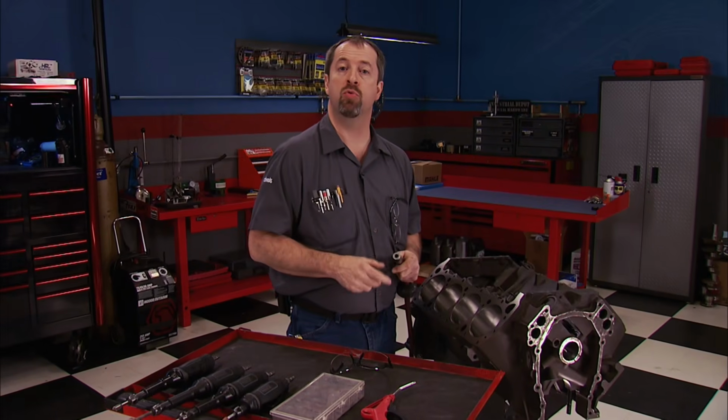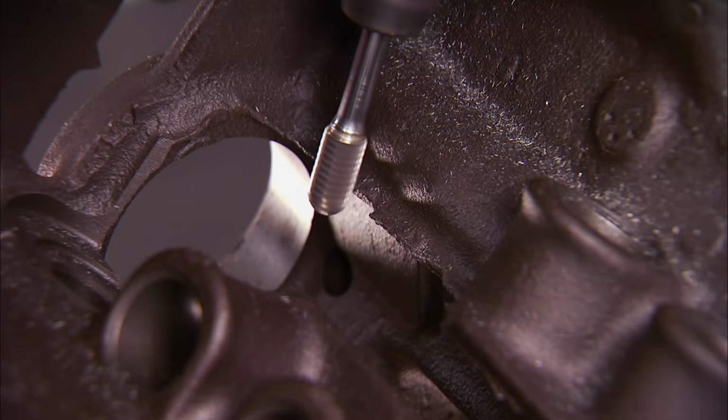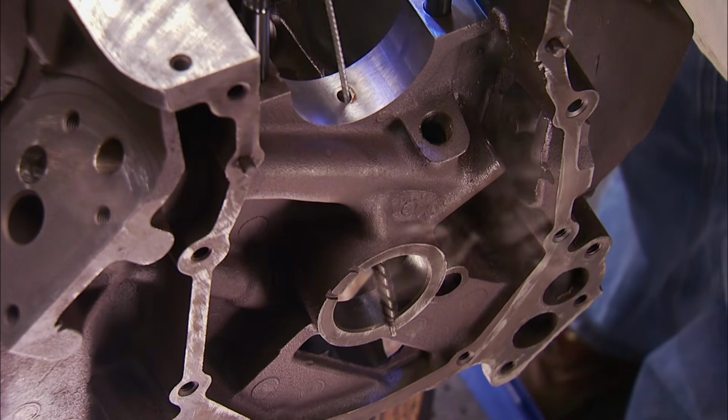All the machining steps were done in top-notch fashion, which goes to show that Shacklett's is a quality machine shop. But before we can put it in the cleaner, we still have a little bit left to do. And since this is going to be a 512-inch racy street bullet, we're going to treat it accordingly, by deburring the entire block and opening and cleaning the oil passages.